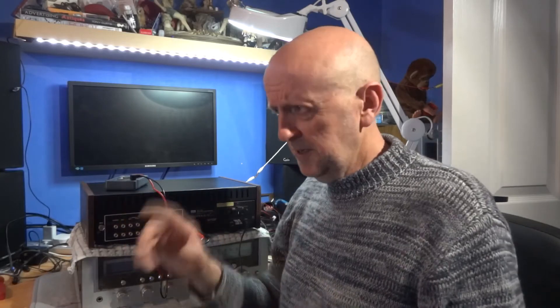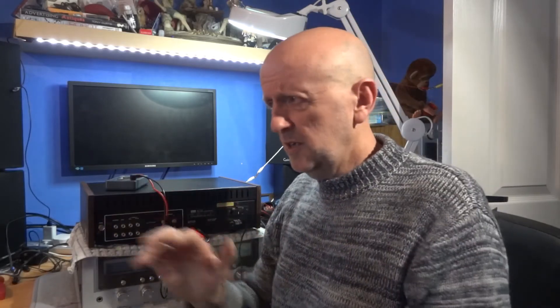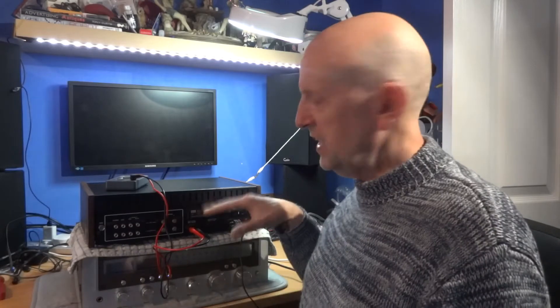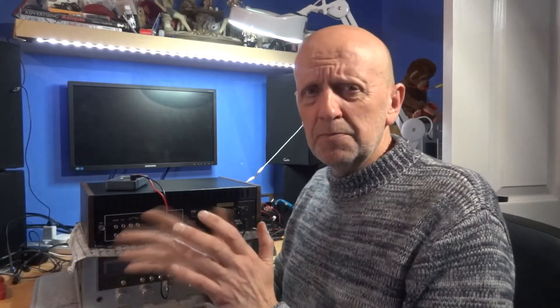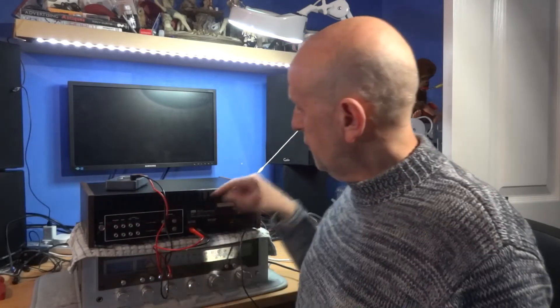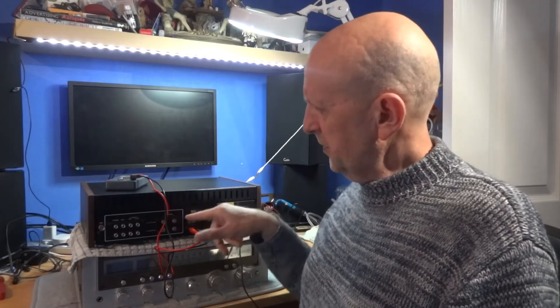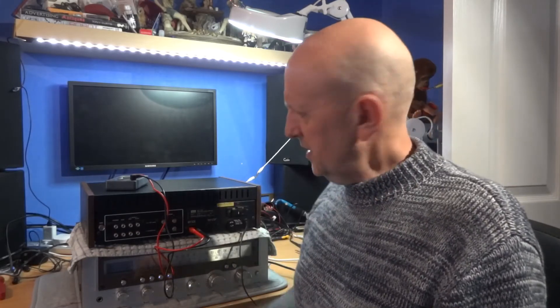In this video I do state 230, but wherever you are I would suggest having this voltage selector just a little bit higher. If you're at 240 volts bang on, obviously leave it on 240. But if you're in the range of 232 to 239, like here, and you've got a 220 selector on the back, move it to the 240 position - just puts you in the right place. I'm going to show you how to do that on a couple of amplifiers, then we'll go on to looking at the speakers.